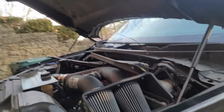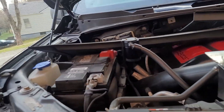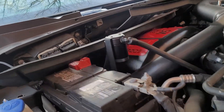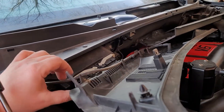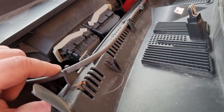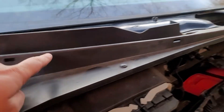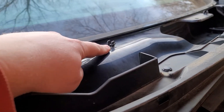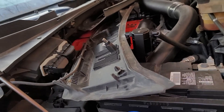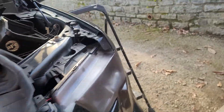Fold them down like this and try to get them seated in there, because you'll need to shut the hood — just enough to where it latches but doesn't fully close. This side for the windshield wiper fluid does have a clip, so when you put it back make sure it goes back in. Other than the three clip holes, you've got tabs in a few spots, so when you reinstall you'll snap it in and make sure it's secure.